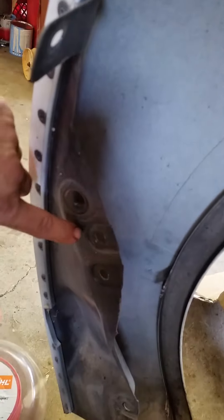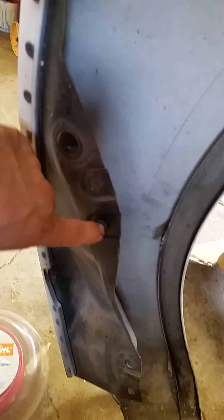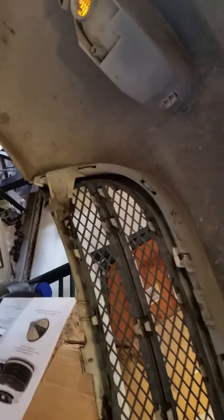Here's a look at what the other side looks like, and here's what the fender looks like on the inside. Take it off by removing all the screws from the top, and there are a couple screws coming from the inside of the inner fender — there's one here, one here, and one here. There's also a bracket on the driver's side. I just unclicked the turn signal lights.